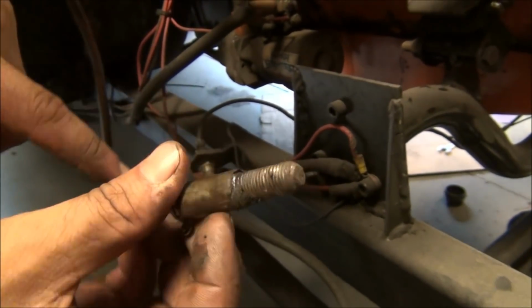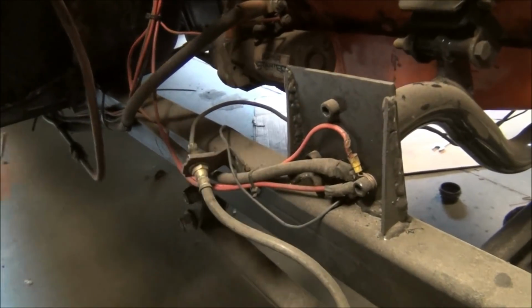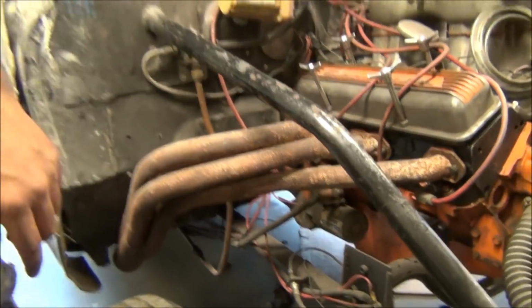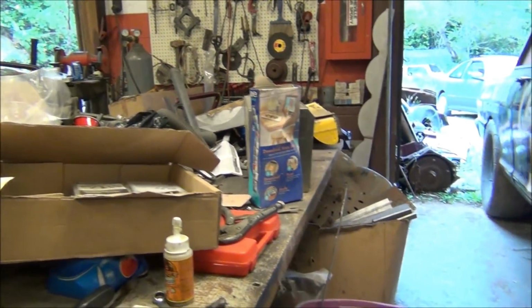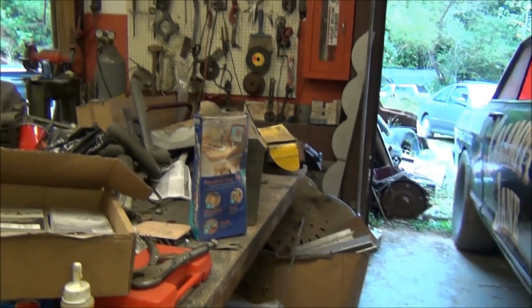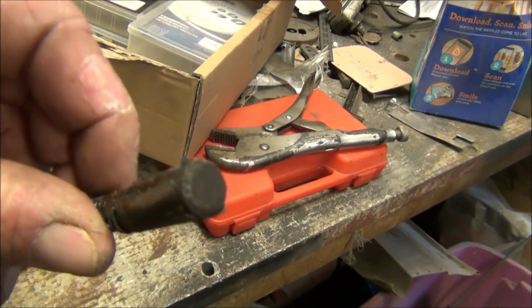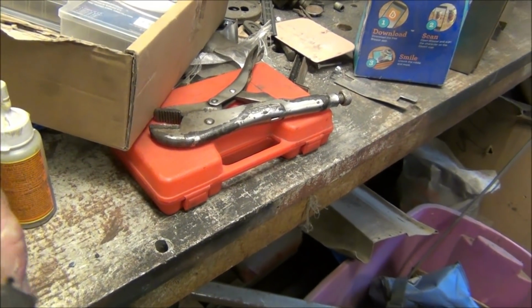The notches, you rotate around and stick the round side facing in with a notch, you hammer it through. Yep, and it'll tighten it right up like a hat band. It won't come out. Simple fix, crude and effective, but that's the old one. We were talking about taking the axle out and welding it and re-honing it and all that stuff. And I said, why don't you take that pin and flip it around where the round side goes against the axle and it'll actually fit in the groove.